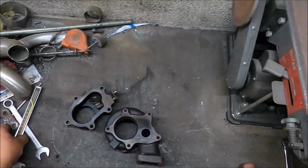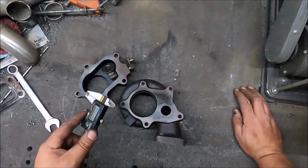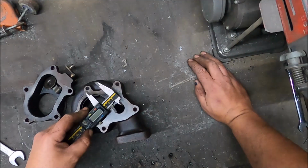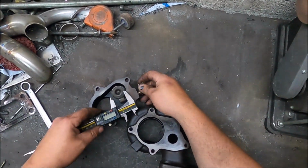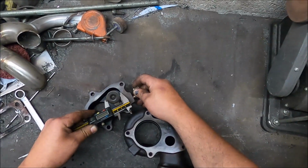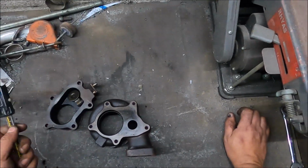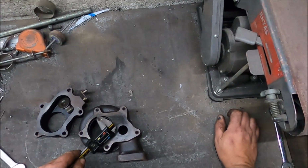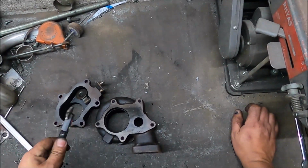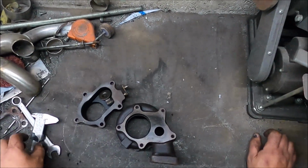First up, my one boost creeps like fuck. So if I can enlarge the wastegate, which I can, then that will help that a lot. So you're talking a 22mm hole currently, but the wastegate penny itself is say 32. So there's a 5mm all round, so 10mm in total between that and that. Obviously I can't take it out the full 10mm, otherwise it won't seal, but it still gives me quite an area I can enlarge it to get close. You know, a couple of mil is probably bang on.